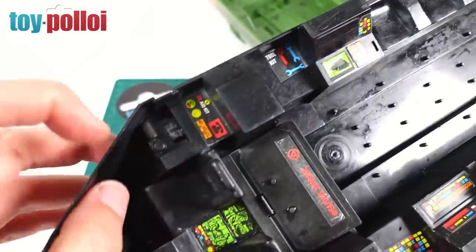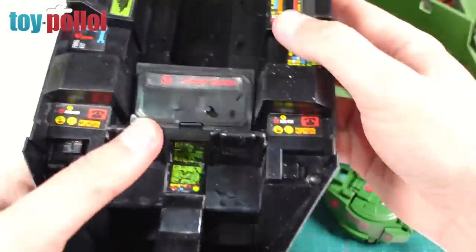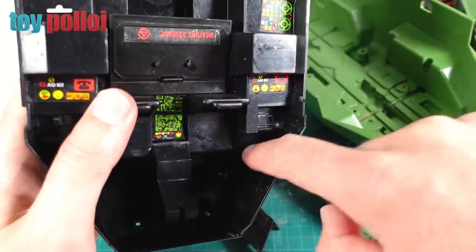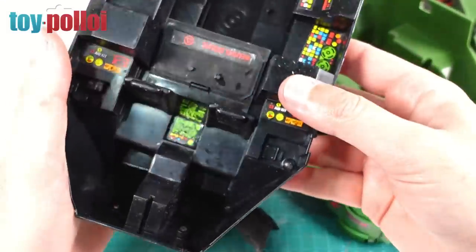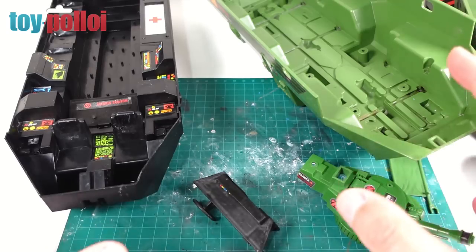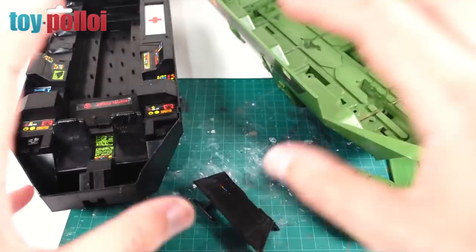There's just a little bit of it left. It's really an awkward place to get to, but most of that has gone. There was silver paint all around here and then dripped all into the side here. This whole wall was painted silver, and as you can see, I've got pretty much all of that removed as well. So it's a process that does work using brake fluid and the kitchen towel just to hold it onto the place. You don't need to submerge everything.